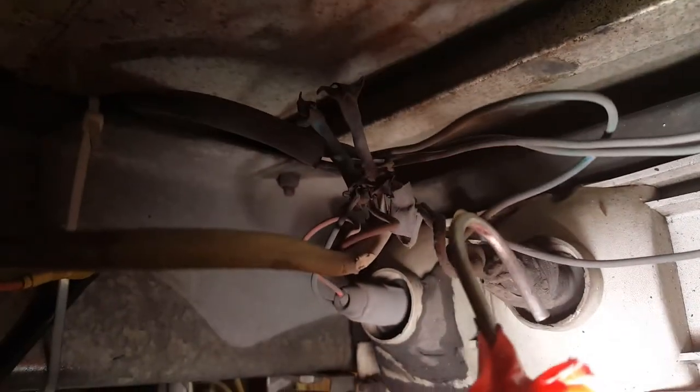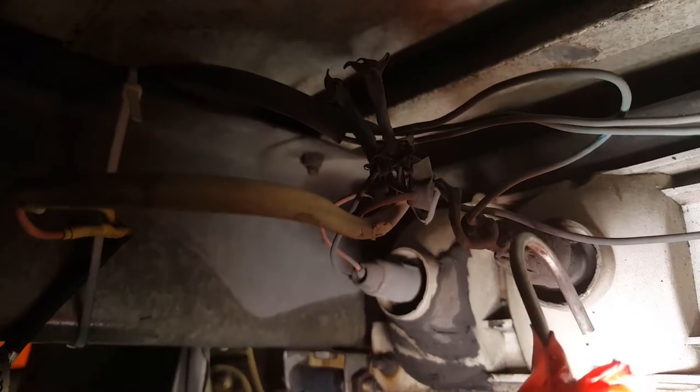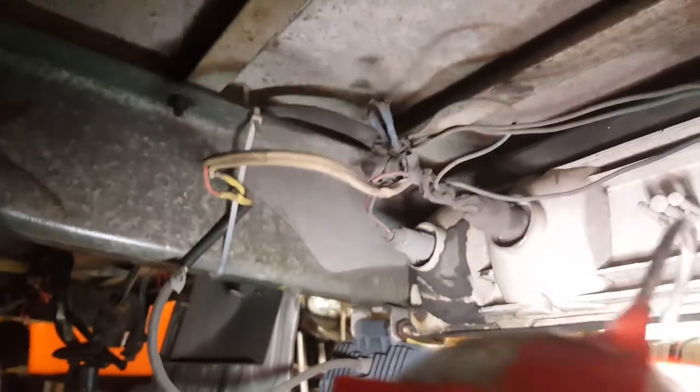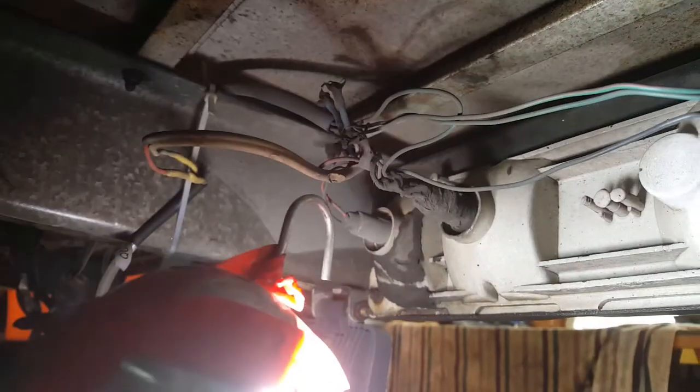You can see there's rain on it and it's been outside, yet because I've siliconed around the edge there's no condensation on the inside. Second to having the color chart, it's important to establish what is the driving and brake light. At the brake light assembly, we're going to cut one of the wires — one's the driving wire, one's the brakes — and find out which is which. It's very very important to label these wires.